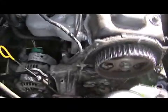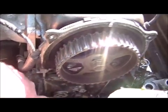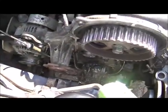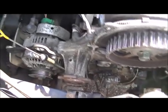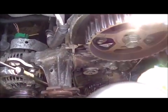I'm now going to take the water pump out, which will involve this, that, and there should be one more bolt under here. I can show you now. Well, I'm going to take them all loose. They seem to be 10mm heads, so quite easy. Having done that, I'll be back with you.